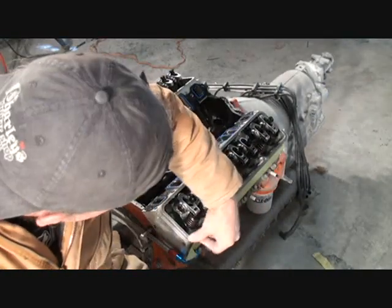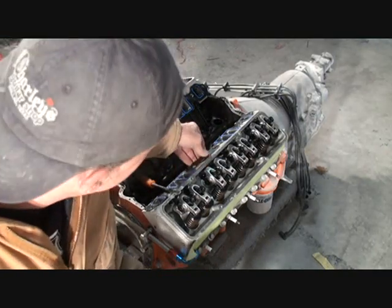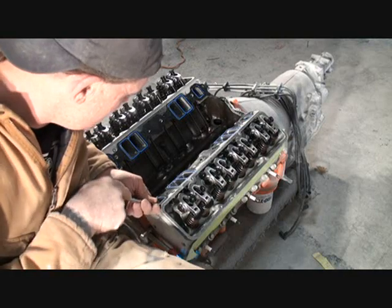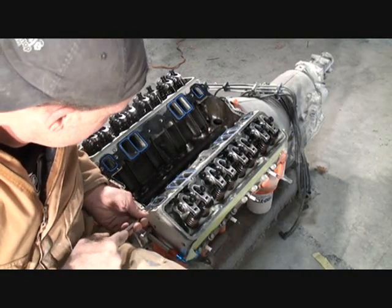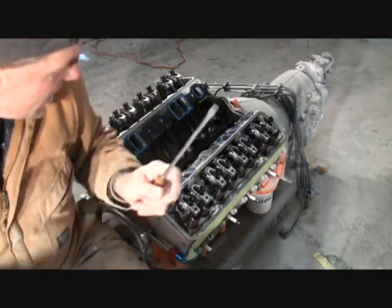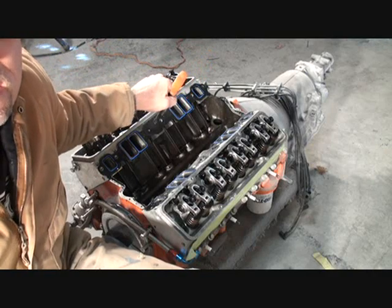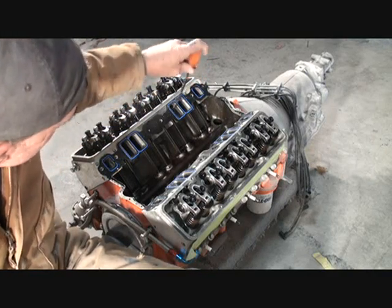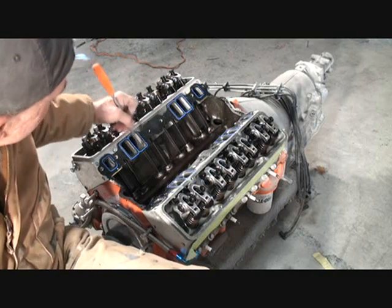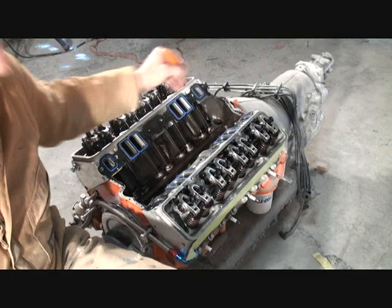What we're going to do on this engine is clean all this up. The gasket kit that this guy used is probably made in Japan, and he used silicone on the gasket. Here's a word of advice: the intake gasket you see right here — you should not have to use silicone on it. It's already pre-sealed right where it counts. The only place you will need silicone is on each end of the intake manifold.